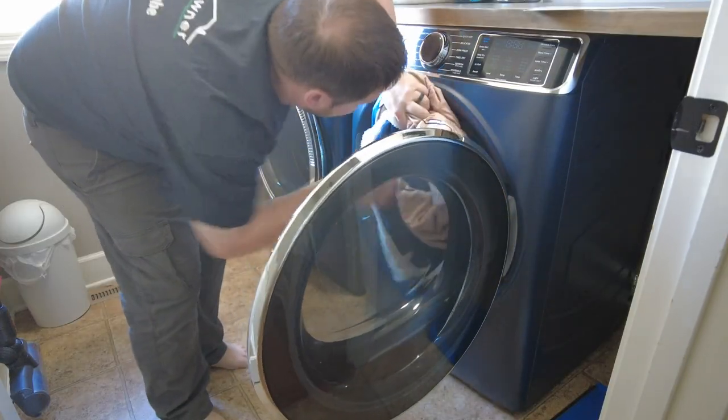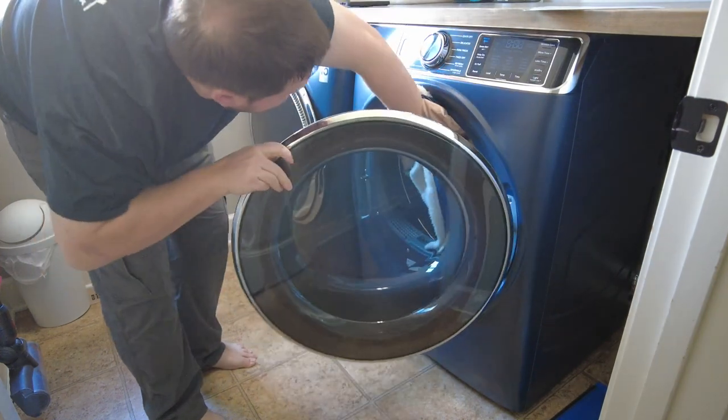It's also a good idea to double-check and make sure your dryer vent is made of a non-combustible material, like rigid or flexible aluminum duct — like what you see behind me. You also need to make sure it's properly installed. Sometimes these vents and hoses are made out of vinyl or a really thin plastic material, and if that's the case, I highly recommend upgrading to either the aluminum foil hose or even solid metal ductwork to hook up your dryer to the wall. Be sure not to overload the dryer either, because stuffing it full of clothes can cause it to work harder than it should, which generates more heat and increases the risk of fire.